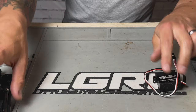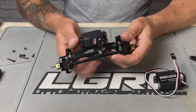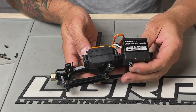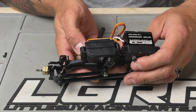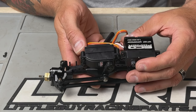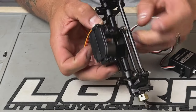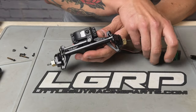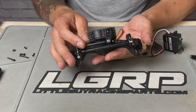Just pausing for a minute because I just got my rear axle assembly all done, got the gear swapped over, got the new KST servo input on here. This is a good opportunity to stop and show you guys the size comparison - look at the low profile on that thing compared to the Eco Power that I just took out. Significantly shorter, probably five to six millimeters or more as far as the length of it. It fits perfect on the Capra axles - this is ideal for the UTB-18, exactly what I was looking for. And the black horn that came off the Eco Power fits on the KST, so I don't have to use that bright red horn after all.